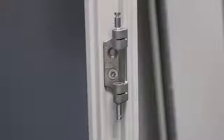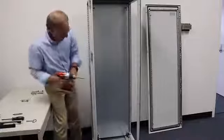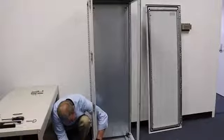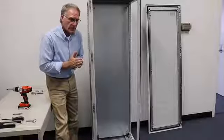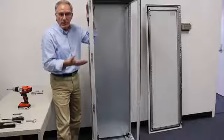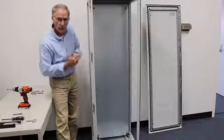Your TS-8 frame, regardless of the size — whether it's 1400mm tall to 2200mm tall — the vertical profile only has seven holes. Four of those are going to be used for hinges or catches. The other three would be for sidewalls or maybe gang hardware. So what you want to do is start at the outside, furthest most points — put your hinge or catch, skip a hole, put a hinge or catch, and that leaves one in the middle. That takes care of your seven.